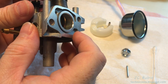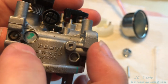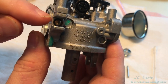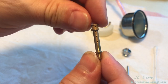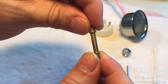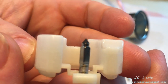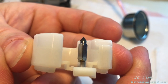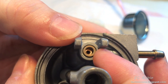Just inside the throttle body you can see some ports. There is a needle for the pilot — it's adjusted at the factory and requires some modification to remove. Under some carbs the needle may be under a plug. We'll see if we can clean this without getting into there via these two ports. A quick visual inspection using light — we can look from one end to the other and side to side to see if there are any blockages. The float should be clean and free of debris. The rubber needle should not be malformed; it should be at a perfect 90-degree angle with no debris. The brass port for the float needle should also be clean and free of any scaling or buildup that would obstruct a good seal.